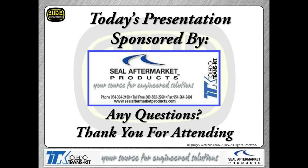it would work fine from park all the way to the overdrive detent, but none of the manual detents worked. Obviously we pulled this from a vehicle that had a floor shifter, and his had a column shifter, so that part didn't work. The customer was happy just the same because he saved some money, and he basically said he never uses anything but the overdrive detent anyway. So that did work. What we were lucky about was the vehicle that the valve body came out of must have had the same ratio in it, because it didn't cause any ratio codes.